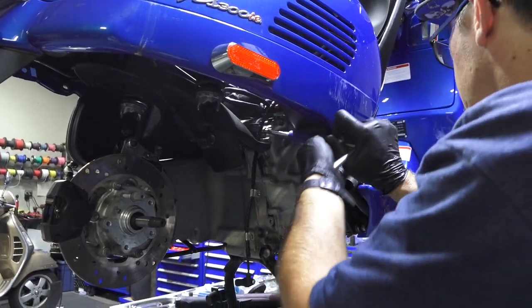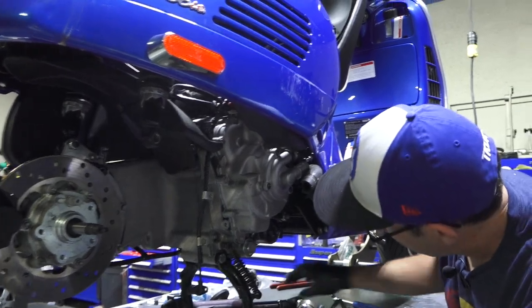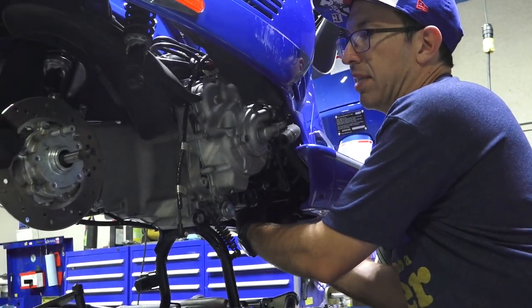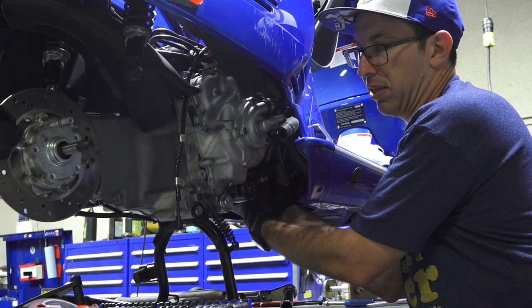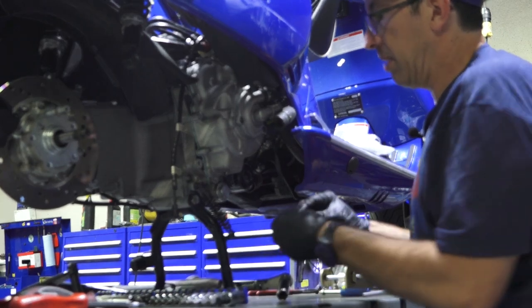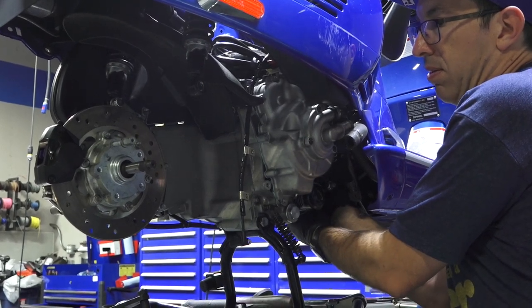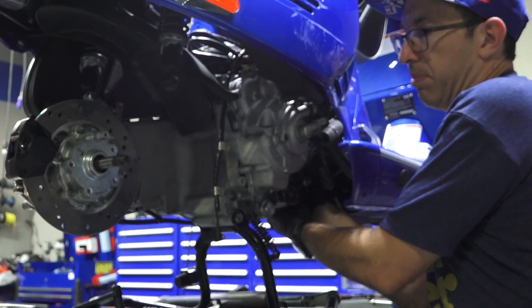All right. Got the spark plug lead, got the exhaust manifold. Got two nuts for that. These brass nuts are pretty inexpensive if they're really rusty, but they're steel nuts, brass or copper coated for the high temperature. If they look bad, then just order new ones, replace them. So all I'm doing right now is just putting this in place.